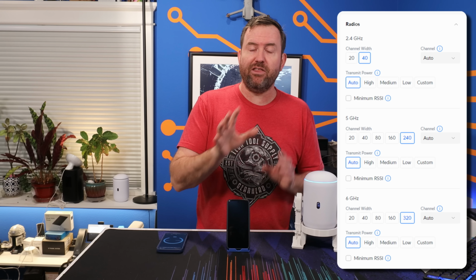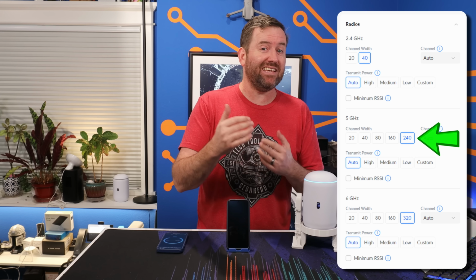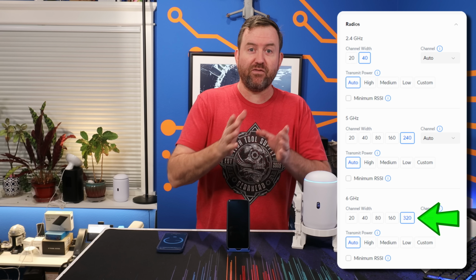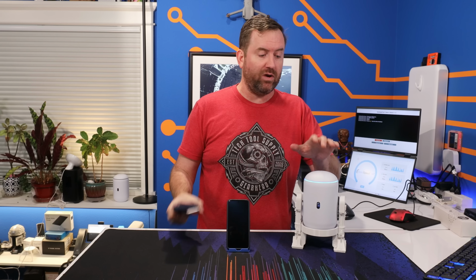All right, quick costume change here. No, in all seriousness, when I originally recorded my wireless test through the UDR7, I forgot to max out the channel width, which is of course how you're gonna get the highest bandwidth from any wireless device. So now I have set the channel width in the 5 gigahertz frequency to 240 megahertz, and I've set the channel width in the 6 gigahertz frequency to a whopping 320 megahertz. So those are very wide channels that allow for a lot of bandwidth back and forth between the access point and any wireless client.